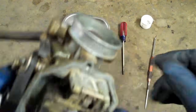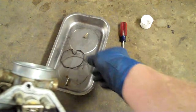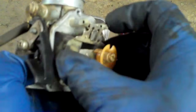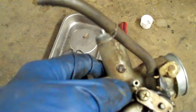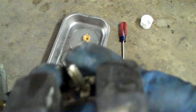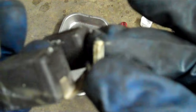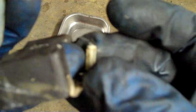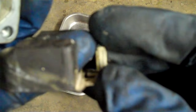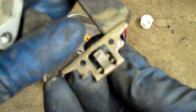If I take out this pin and set it aside — it's just like in the back of your toilet, you've got that little thing, except this is gravity fed instead of water pressure fed. This is called the needle. It looks more like some kind of Empire State Building to me. It's got a little spring-loaded clip that goes on the float.